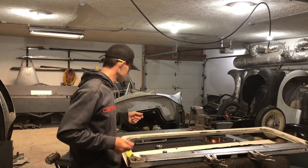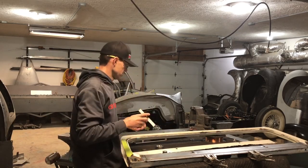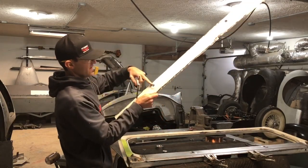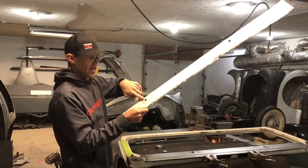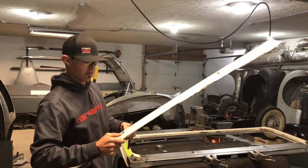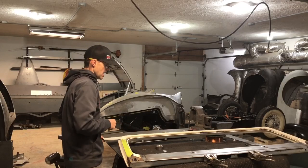Then I used a 90-degree straight edge on this edge because it's 90 degrees. I found center of that little notch — measured it, and that was an eighth inch — so I scribed my center line. I'm going to show you the finished product; it came out pretty cool.